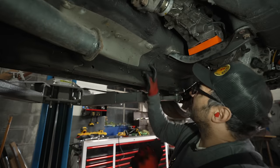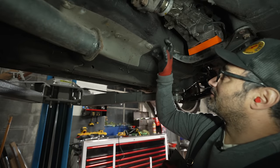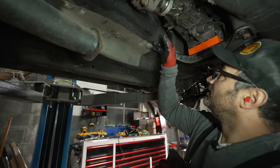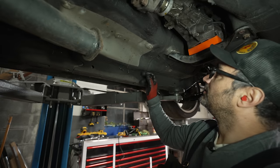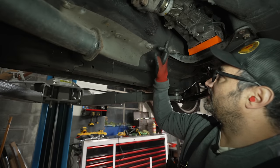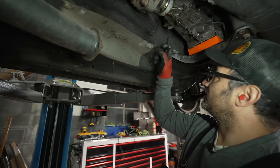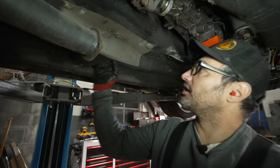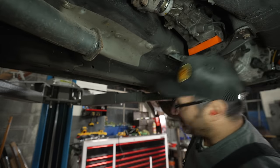This is the last ridge — it sits just behind this. That's why we're underneath to make this first cut. We're going to mark the cut right along here, then go inside and make the rest of the cuts once we're clear of the transmission. It's just a straight cut here — cut along, cut the back, cut it out, slap it in, weld it up.